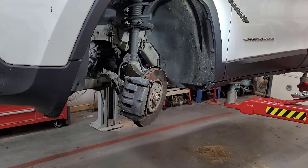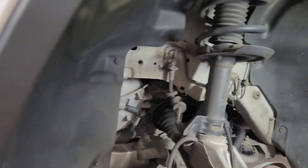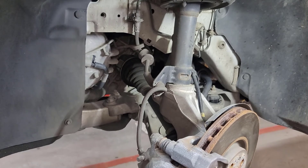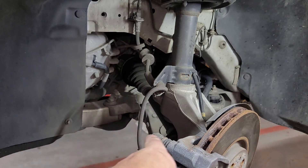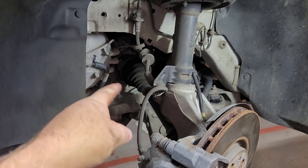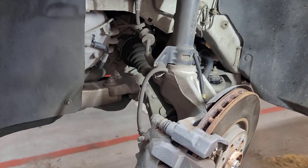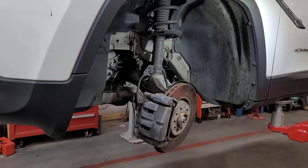Brake service on this has actually been done before, so I invite you to look at the brake hose. What somebody did is they wrapped the brakes up — wrapped it around this way when they put it on, which twisted all the brake hoses. Whatever shop did that, I don't know what to say. I'm going to be nice and say: you need to start paying better attention to what you're doing with your brakes. These are wrapped up.